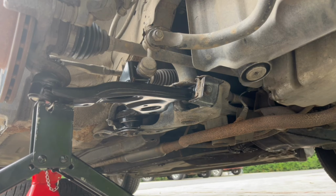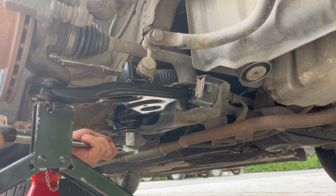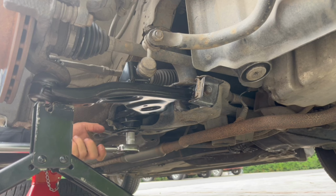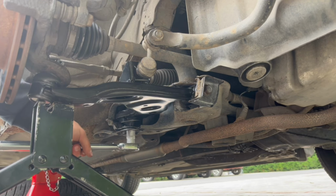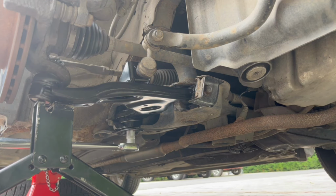Now the rear one is 80 plus minus 16, so 84 should be okay. Now this rear bolt is always annoying because if you don't tighten it a lot, you'll have a lot of wrenching to do on it until it gets to proper torque.